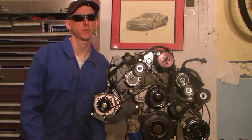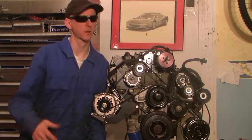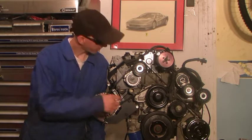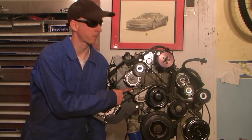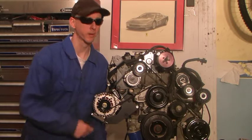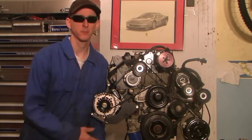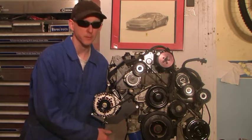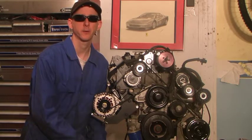In this miscellaneous segment of my video, I'm going to do a couple of odds and ends that I couldn't really fit anywhere else. One of them being the water pump hole that we now have open — we're going to plug that. I'm also going to put an elbow in on the oil pressure sending unit so it will clear the alternator.